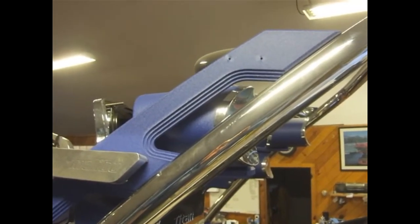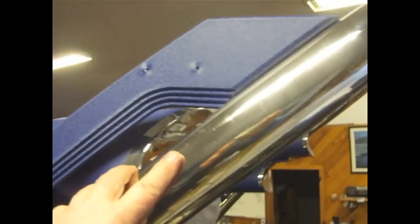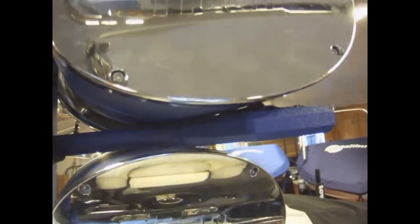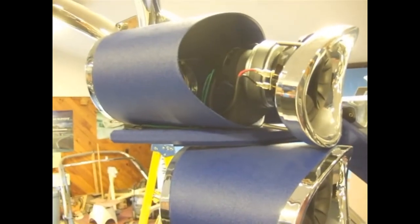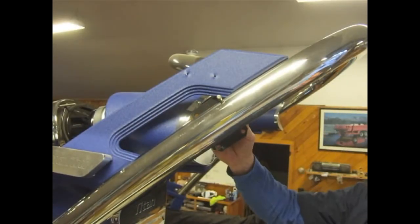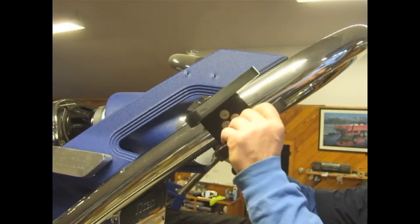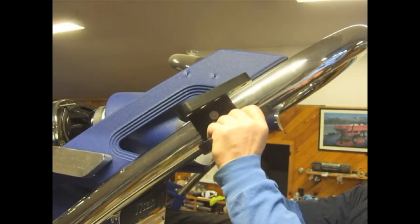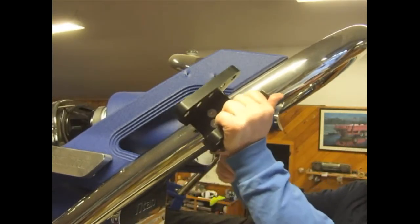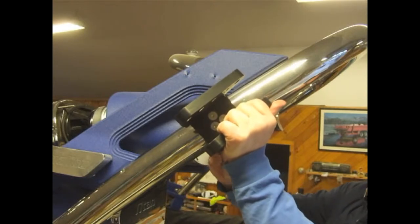The upper bracket mounts up tight to the top opening on the rear support of the tower. If you have speakers on your tower, you will need to remove the top speaker from the shelf and move it backwards just enough to mount the brackets. There are four machine screws inside the can holding it to the shelf, and that seems to be the easiest method. The clam shell itself — you'll see the top bolt goes right up tight to that notch. Go ahead and mount the clam shells together with the bracket on the outside and just snug it into position.